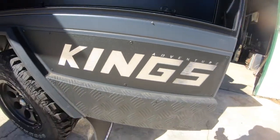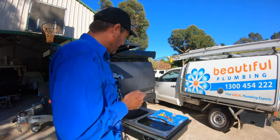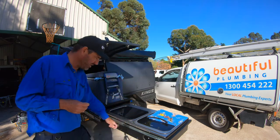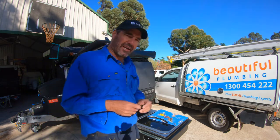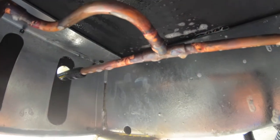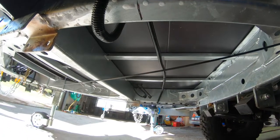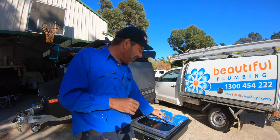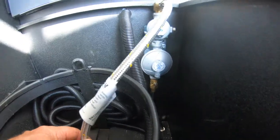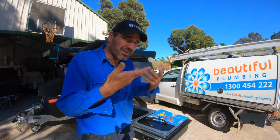This Kings Adventure MT1 camper — I've just done a gas install on it, put three bayonets on and a hot plate with a quick connect. I've welded all the T's, bent all the pipe up in one go, and sleeved it all. It looks really professional. I've only got two flared joints — one for the regulator, which is easy to check when you're opening bottles, so you can smell any leak quickly and you're not blowing a bottle when you're four days away from anything.